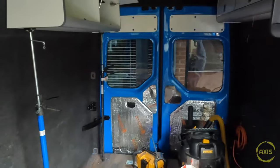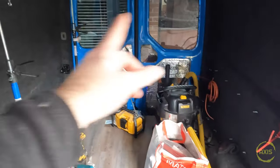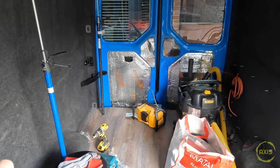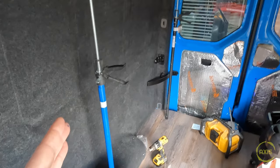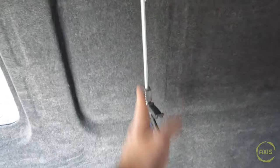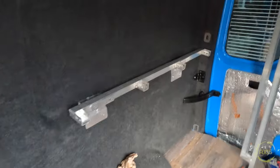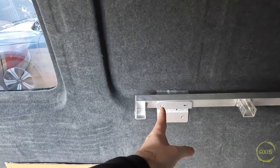It's starting to take shape. I said I was going to put my bed in first, but I've not done that yet. So what I'll do is get this locker in first, mount the brackets, build the outside frame of the bed. I might have an issue because the bed isn't part of the Evo kit - someone else has done it - and I'm hoping where the bed falls, roughly about here, the shower should line up. I'm going to trial fit this aluminium bed frame and look at the alignment. The shower has got to come up to this point here, flush against that one. And look how far out that is - miles out. Nightmare.